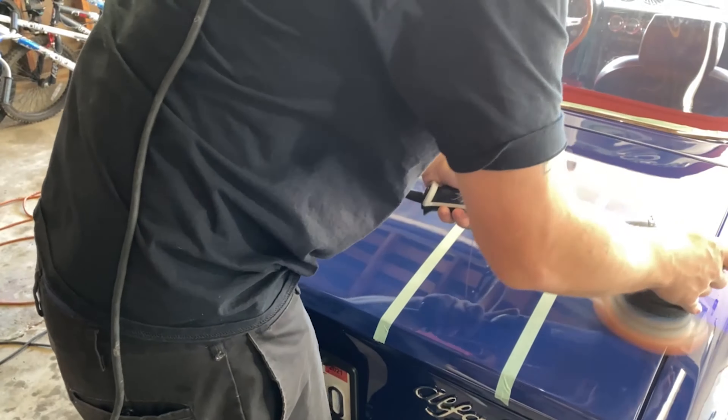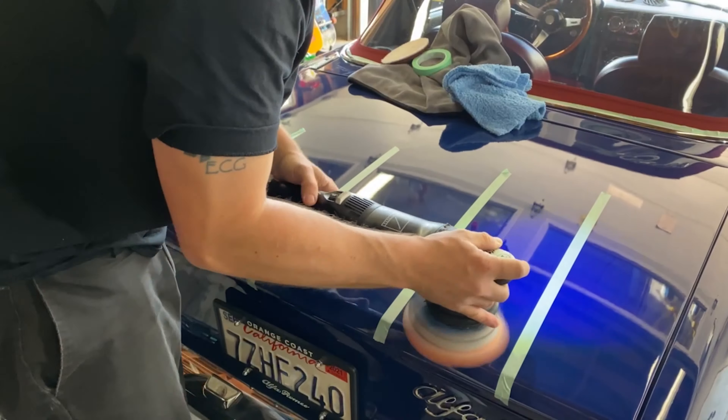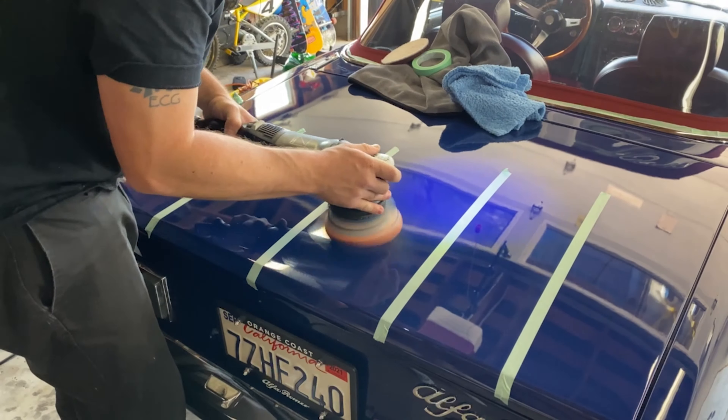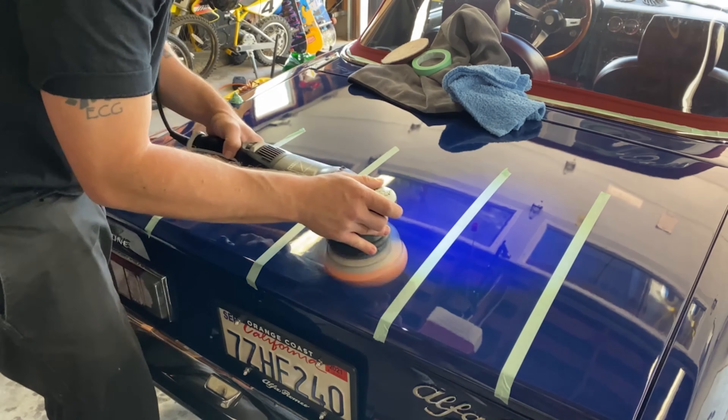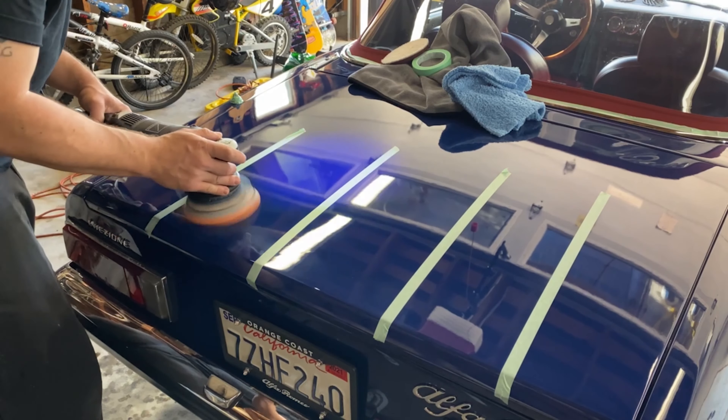Let's see the results: Classic Cut did a pretty okay job — still some defects left, hazing is pretty minor. Last Cut left a lot of big deep scratches. F-100 left weird haze everywhere as predicted, and the ProJ compound also left a similar kind of haze. Meguiar's 110 looks pretty good. Now I'm going to go over all of these with an HDO orange cutting pad from Lake Country and Shine Supply Classic Polish. Jeremy Stevens at Shine Supply says this is one of the better pads for breaking down Classic Polish — the black pad doesn't always break it down all the way, which can lead to issues when you panel prep or put a coating over it and it pulls haze back out.